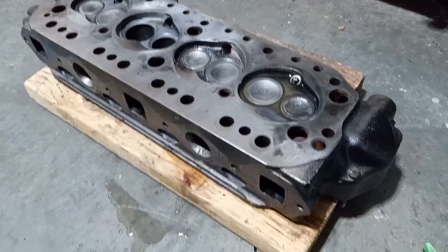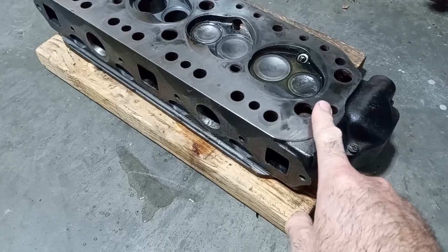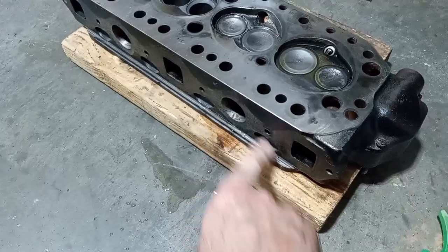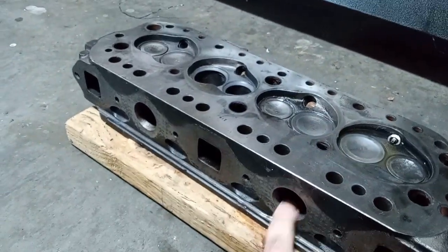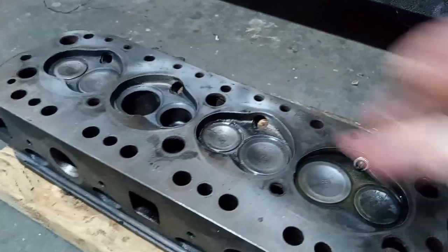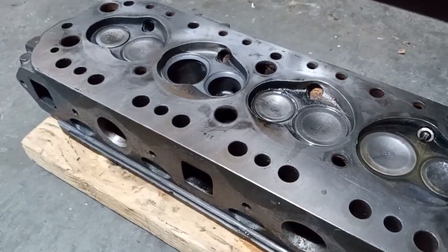When guys say you've got to send it to the machine shop to get the seats done, this is a little bit of a water test to see what's leaking through. After a couple of hours we've got a lot of water leaking. This one's not too bad, but the intake side is really coming through — I'd already tested those and they're really coming through as well. So yeah, pretty much a fail.